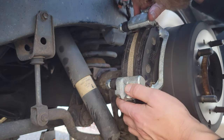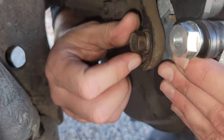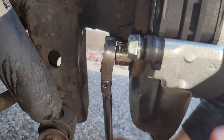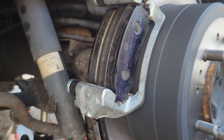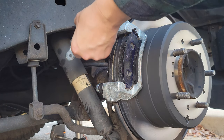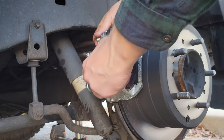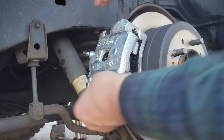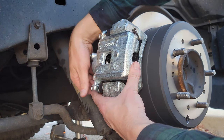We have our new caliper and we're sliding it over top of the new rotor with the new brake pads on it. Go ahead and grab those 17 millimeter bolts and get those installed to hold the caliper in place. Get it tightened down, but we'll go back later to make sure all bolts are properly tightened. Then take a shop rag or glove and spread some brake grease lubricant on the back surface of the brake pads so we have smooth lubrication between the caliper and the pad to prevent noise. Once we get the outside part of the caliper on, take those two 14 millimeter bolts and tighten them up to get the whole caliper back together.